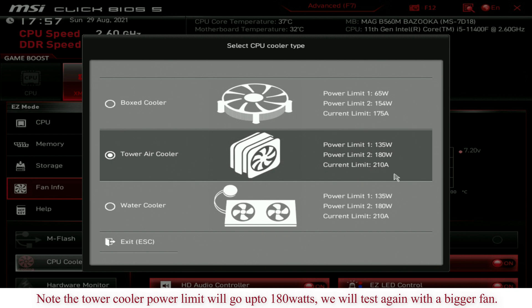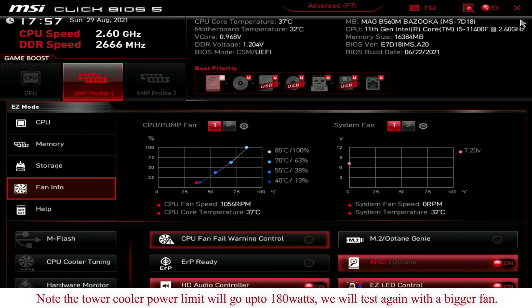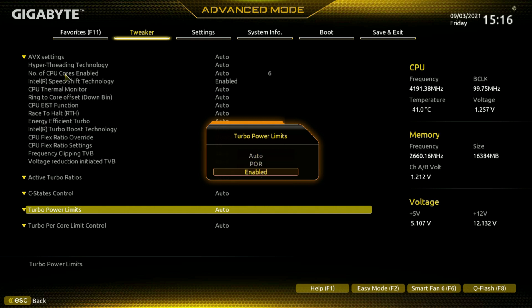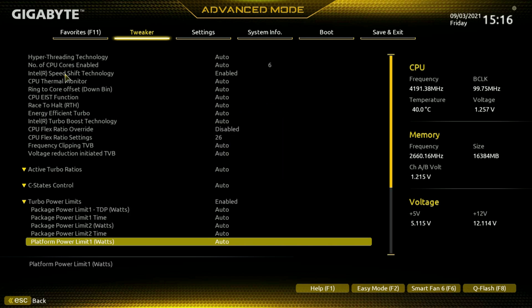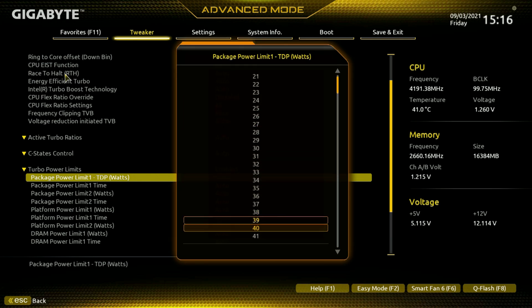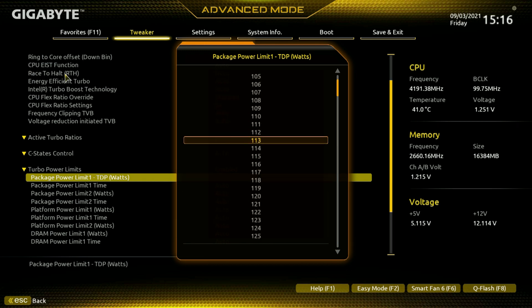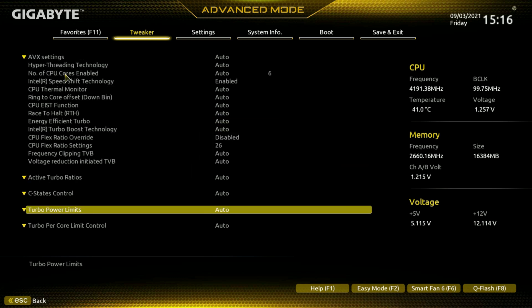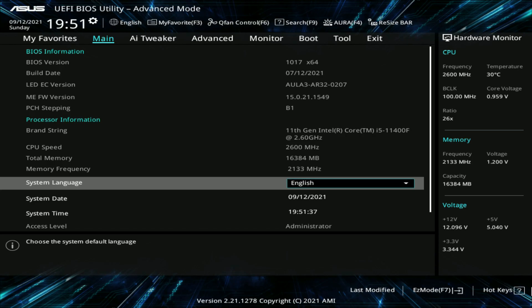You need a good cooler. I did do a test run with an Antec A30 CPU cooler - extremely quiet - but it did not stop it going up to 100°C at 125 watts, so don't bother buying one of those if you want to run at 125 watts. For the Gigabyte BIOS, go to Turbo Power Limits, turn on Enable, then you have two settings: Package 1 and Package 2 - set both to 125 watts or higher. On Auto it runs between 65 and 125 watts, turboing to 125 for about a minute then dropping to 65 watts. You can set both to 65 watts for a nice cool result.